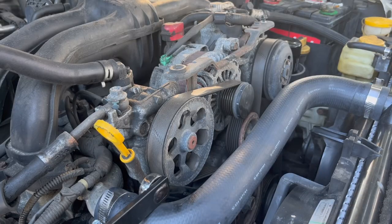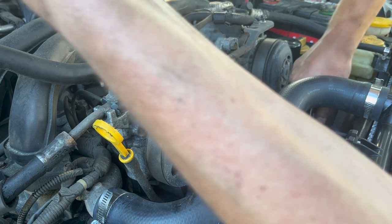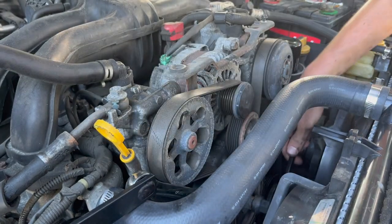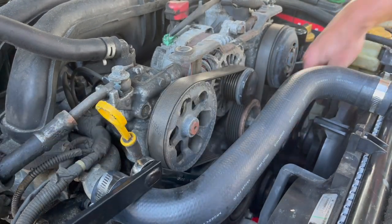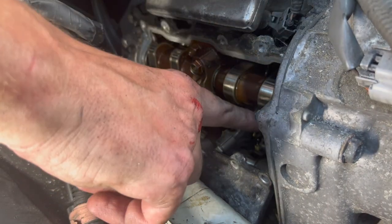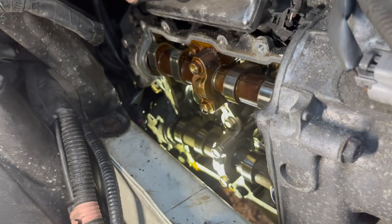What I'm going to try to do is loosen the tension with a 22mm ratchet and try to move the crank pulley. I found a shorter socket so it should work now. I'm very optimistic that it's going to work now because all of those are away — none of them are facing me. And it's out.